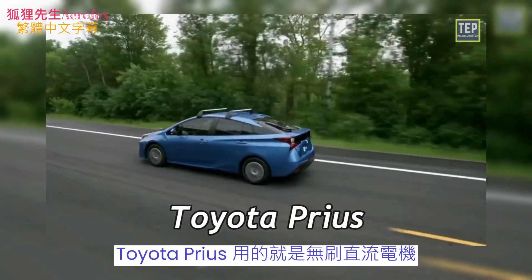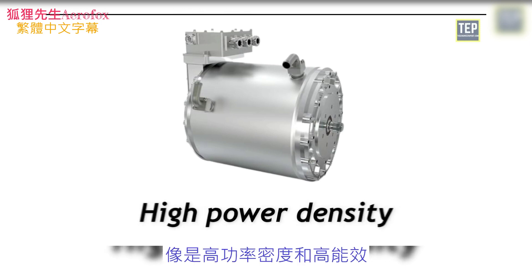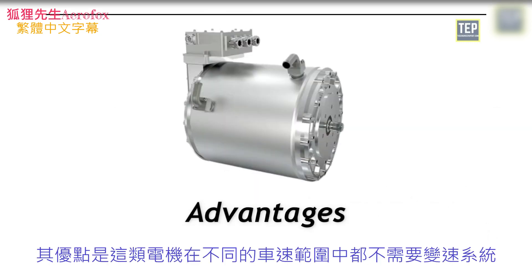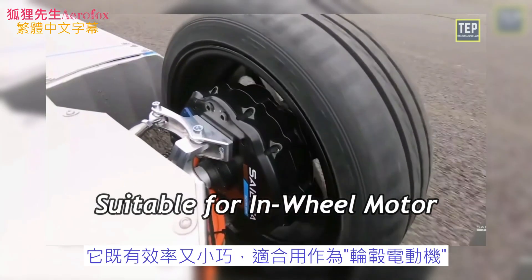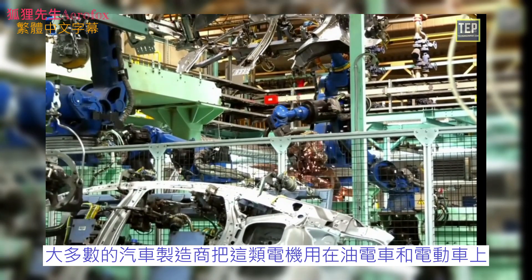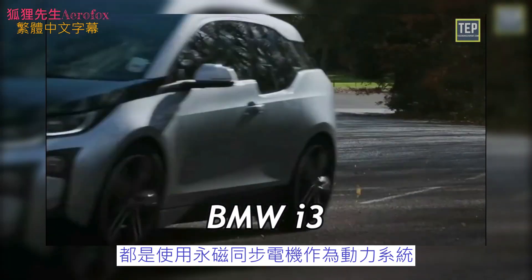The permanent magnet synchronous motor has permanent magnets on the rotor, similar to brushless DC motors, with traction characteristics such as high power density and high efficiency. These motors are available for higher power ratings but are also more expensive. The advantage is that they can operate in different speed ranges without a gear system — they are efficient, compact, and suitable for in-wheel applications with high torque even at very low speeds. Most automotive manufacturers use these motors for hybrid and electric vehicles. Examples include the Chevrolet Bolt EV, Ford Focus Electric, Nissan Leaf, and BMW i3.